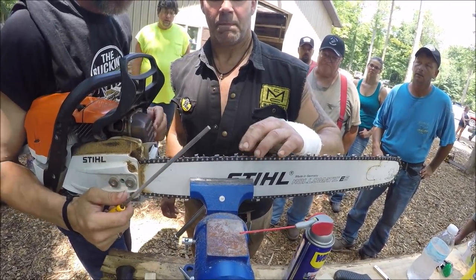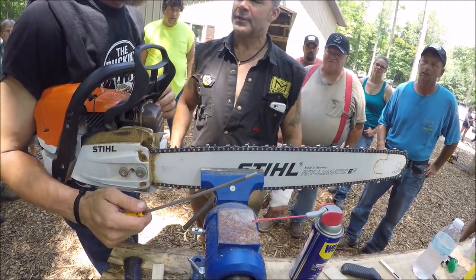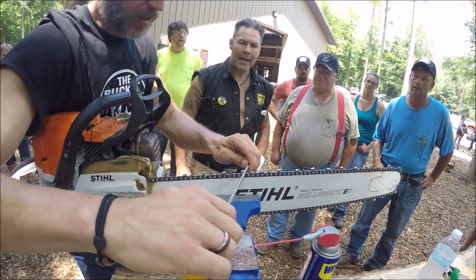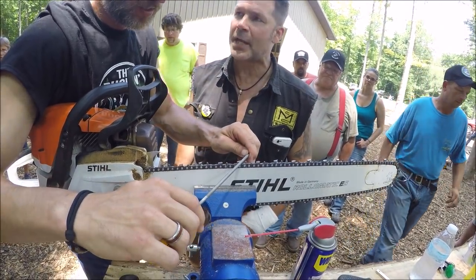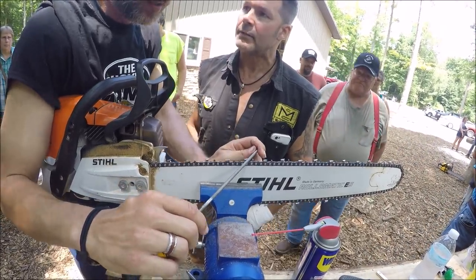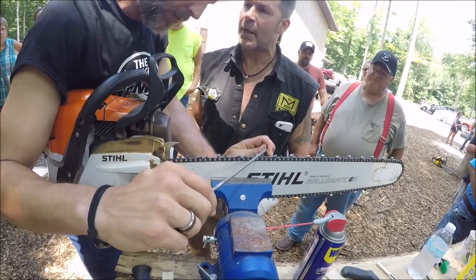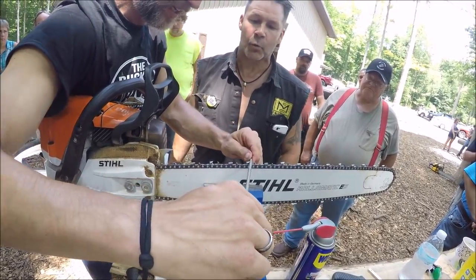Okay, you should have that by now. And so what's happened is you might need to change your angle that way. Because that chain wasn't in bad shape, or that tooth wasn't. What's happening is you're missing it. You're not even hitting that corner somehow. So I'm coming this way too much. I'm skipping that corner. You're missing the working corner.